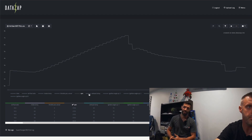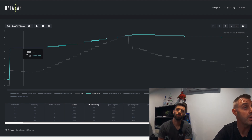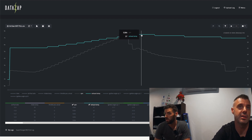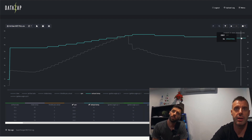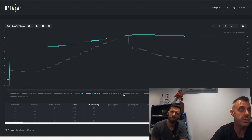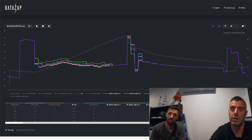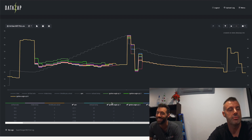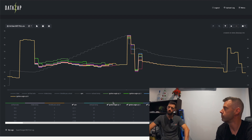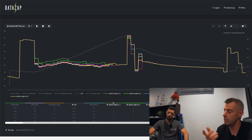Exhaust temp - that's something HTE wanted us to log. The values are at 26 - maybe that's 26,000 of some unit we don't know the reference for. Overall it appears to be quite an aggressive tune timing-wise and it's running really lean. This is why you've got to check things. It might be adapting to those new sensors - possibly we didn't do enough pulls.